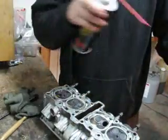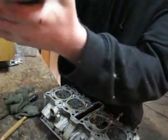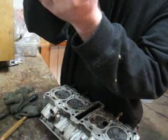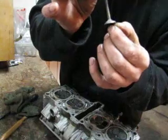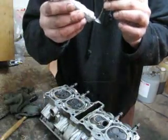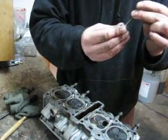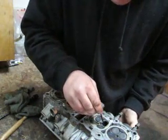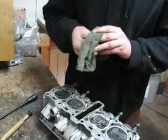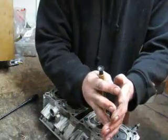Take it out and inspect it. It's pretty shiny. There are a few small pits in there I can still see. If the valves are too badly pitted, you could do this all day long and you're never going to get them to seal right, which means you'll never get it to run right. So there's a limit to how pitted it can be, and you can only do this level of work.